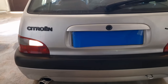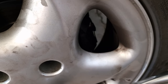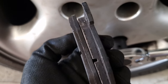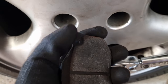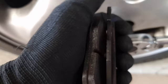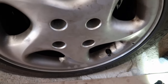Change the brake pads with some new ones, because the old ones were pretty bad already. I also actually fixed - put a little kit there and fixed some with some lube as well, because this was a bit stuck, too dry, and there was like crust. This pad wasn't really slipping like it should - it was very full of crust and rust. Now they are sliding very well with the new ones. Tightening up the wheels - and that's the last bolts. Ready to go to the next wheel, let's go.